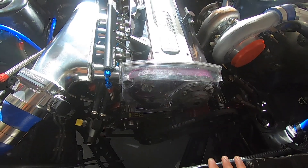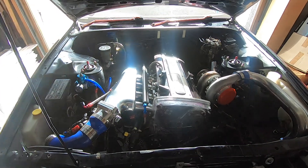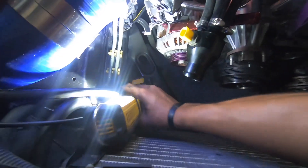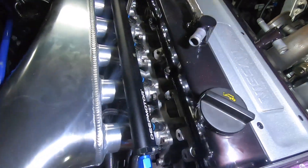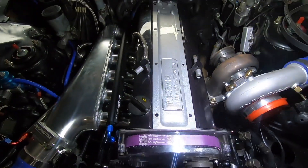Probably gonna get on the belts first and go from there. Alright, so I'm gonna start on the head bolts. To take off the head bolts you've got to take off all the valve covers, so I need the Phillips impact. Take them all off — all the bolts on the sides — take off the center cover to get into the middle bolts.